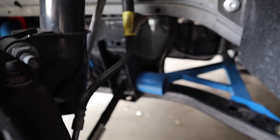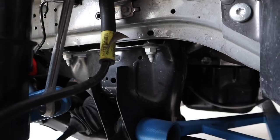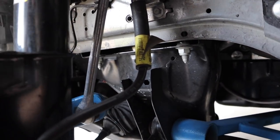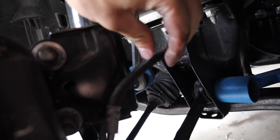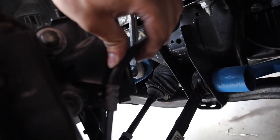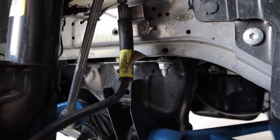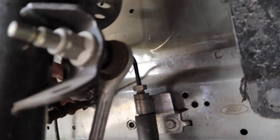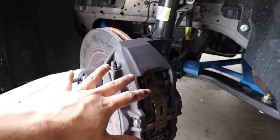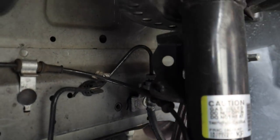Here's exactly what I was talking about earlier — right here you have this rubber brake line. It's thick rubber, it works, however when you press the brakes it does have a little bit of play and it tends to flex, which makes your braking response much slower than with a steel brake line. The reason the whole thing isn't already a hard line is because your suspension moves — if you had a hard line throughout, it would just snap as the suspension moves.